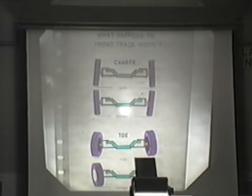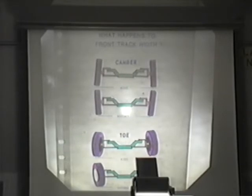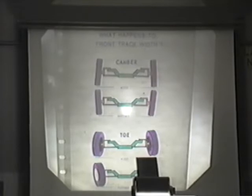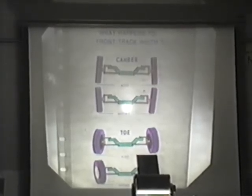These are some of the measurements. Anyways, I was saying, when I do a search, I usually have a shorter list of the ones that are closest, and for a serious case, I generally run a second list with much wider specs. Like I'll go sometimes up to an inch and a half on the track widths, and 4 to 6 inches on the wheelbase, plus or minus, to give them a longer list and say, okay, this is your short list that's close, but here's another bunch of vehicles that are in the ballpark. Don't exclude them in case there's errors in measurements or alignment problems and all that.